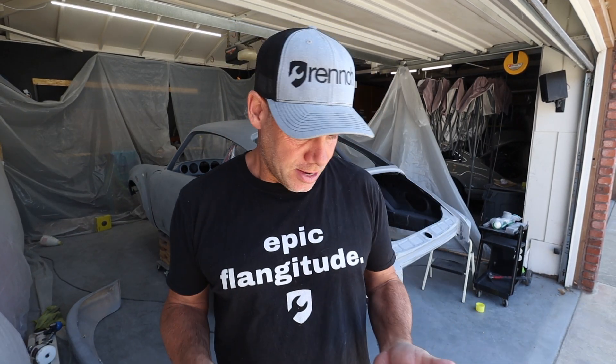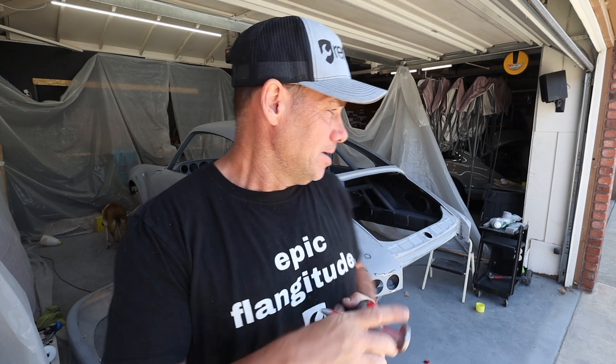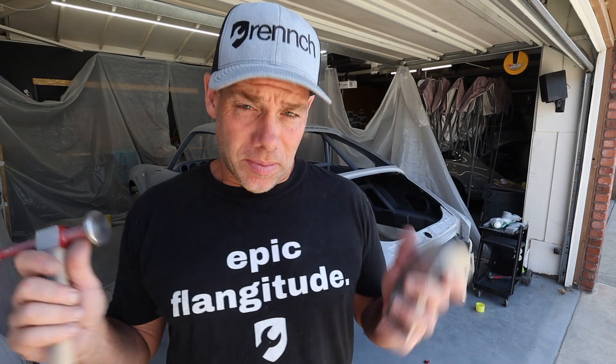That was so cool to have Henry here. I have a plan now, which is nine-tenths of the issue. I've got my hammer and dolly, I'm going to knock down these high spots, hit them with my new USC Icing glaze, address any other spots I can, then give it one more primer in different spots and the whole car — then it's off to Henry's place to get painted. I'm going to put some headphones on and listen to book three of the Jack Reacher series. Now let's go hammer some stuff.